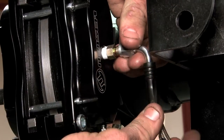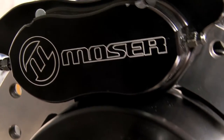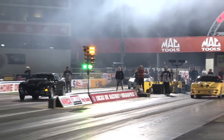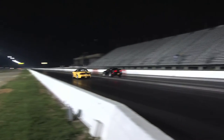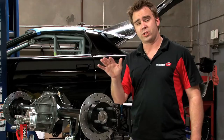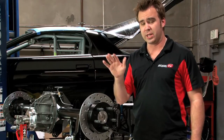Finally, install the brake line fittings and make sure you do not over-tighten. Now the first time you take this brake kit to the track, just plan on doing some break-in. Three hard stops will help properly burnish the pads. It shows in the construction of this brake kit exactly how much time Moser has spent engineering this system.